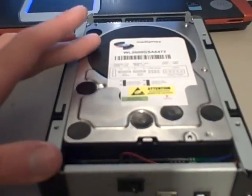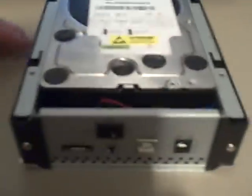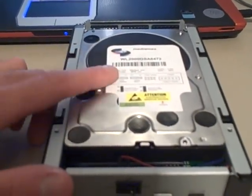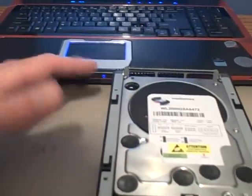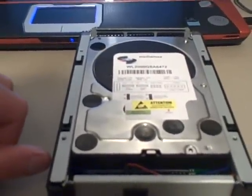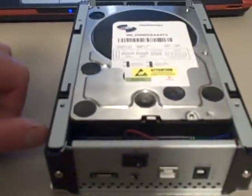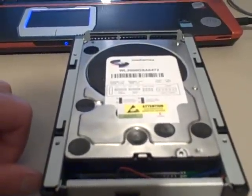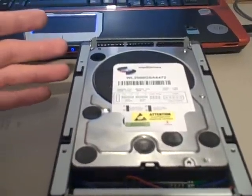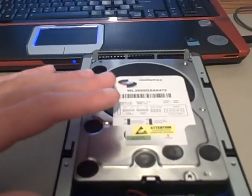So there's some buffering and latency issue here. It might just be software, or it might just be my computer — judge for yourself. If you put this in an external enclosure, it might not do well if you decide to disable the onboard buffer or disable the Windows caching for this drive. It might just be my setup — you should look online for more situations like this. It should theoretically perform quite well even without any buffer at all, because it has very low latency with accessing and high density. But that's my only gripe. Other than that, this is a perfect drive.